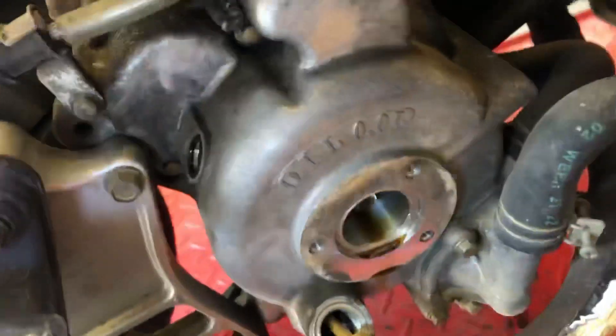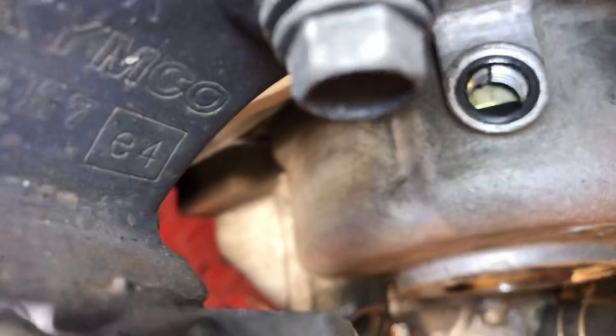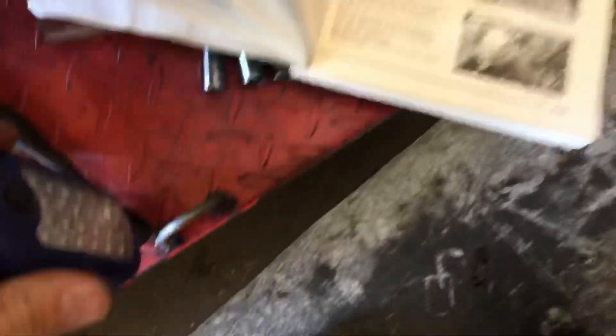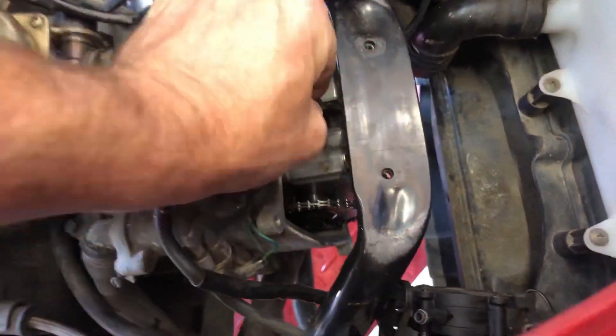There's a small cover here you can remove with a screwdriver to see the T-mark. It's hard to see on camera but you can just make out the 'T' — there it is. Down in here is the little index hole they're showing in the manual. At this point we need to check the clearance. One feels more loose than it should, and the other one I can move as well. The clearances are supposed to be 0.1 millimeters for both intake and exhaust, so let me get the feeler gauge set up.